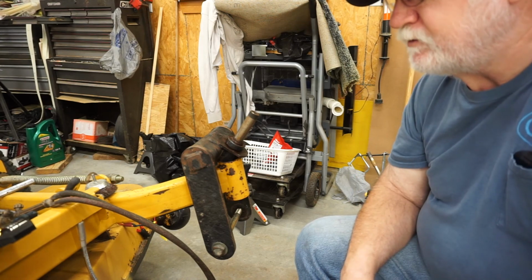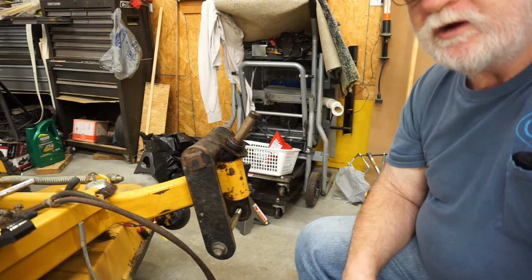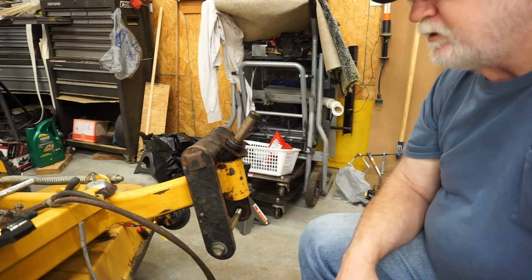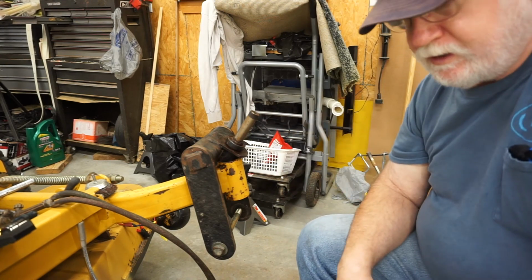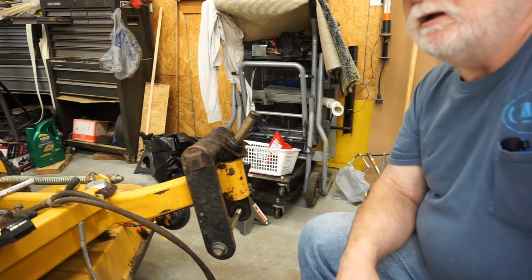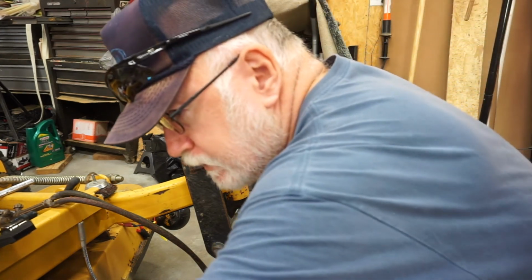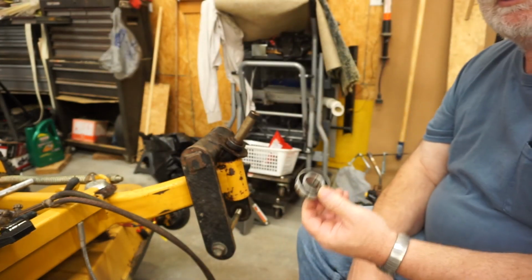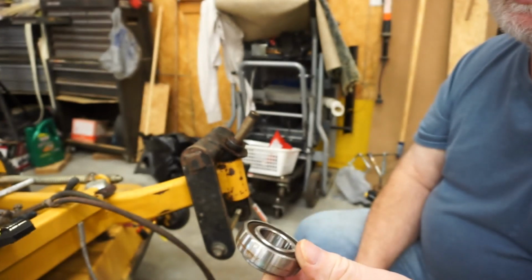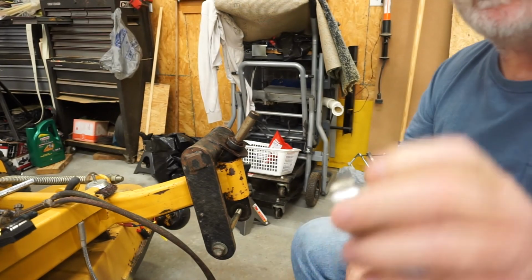But that's life. So this little video is taking a little longer than I'd hoped it would, but we will get this all cut apart and we'll get new bearings on it. The bearings are sitting over there, and we pretty much have everything we need to get it all back together. Now, I'm going to say this, and here's one of the new bearings right here. There you go, and it's a SA205-16.